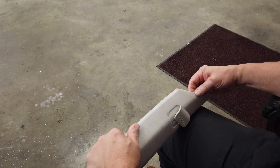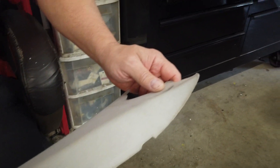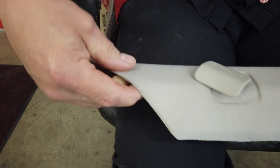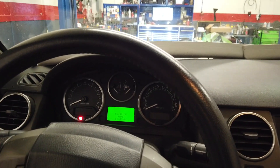We used a high-temperature fabric glue and got our A-pillars glued back. Let's go ahead and put those A-pillars back in — it's a T30 Torx bit. Let's go ahead and put these A-pillars in and we'll be done for today. Let's cut on some jams while I work on this car.